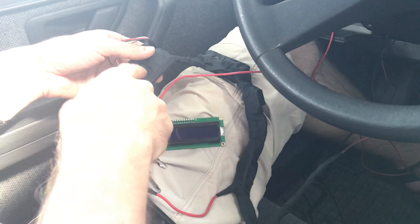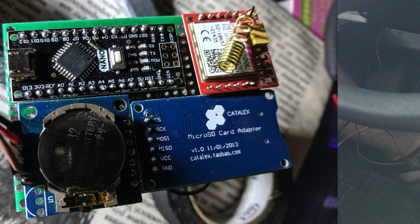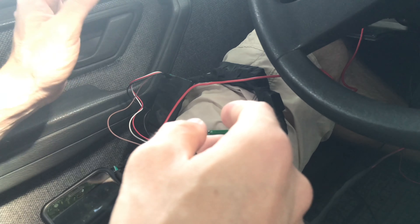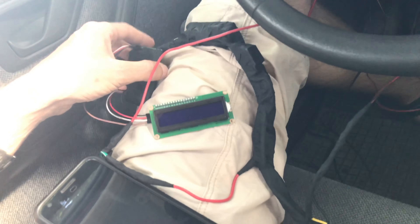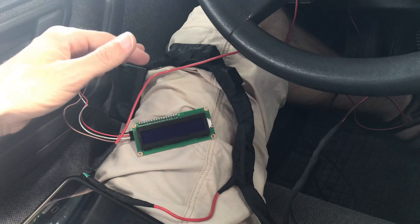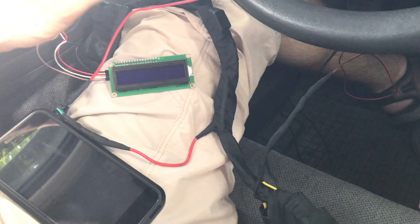And how do I do it? Here I use an Arduino Nano and SIM-800L GSM module, which allows connecting to GPRS internet and also calling or sending SMS. This is a test screen I will disconnect before installing it in the car. I also have three relays — two for 12V from the car and one 5V relay for Arduino.